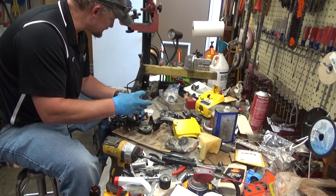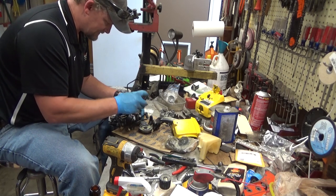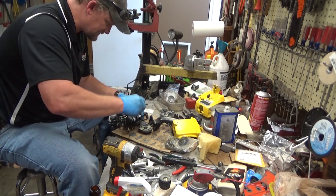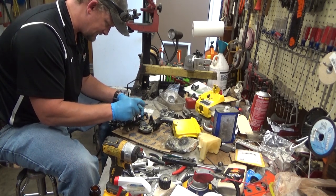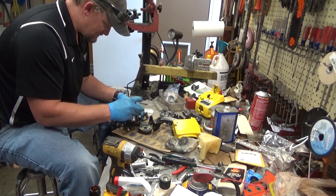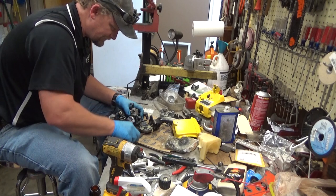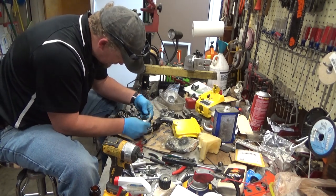We need to set our clearance to the flywheel, but we're not quite ready to do that yet. We need to get the points cover on. Actually, I'm going to roll that over and make sure that it's opening the points to the right distance. These things aren't super finicky about that. The spec usually on these calls for about a 0.015 opening, as long as you're in the ballpark. Usually they fire just fine. You want to be as accurate as possible, but...